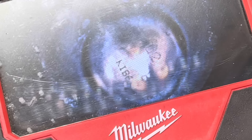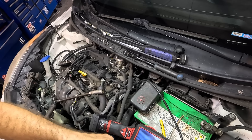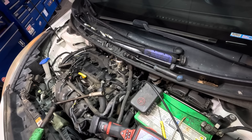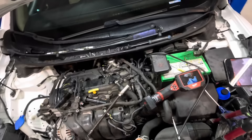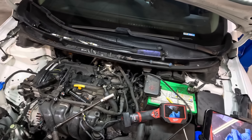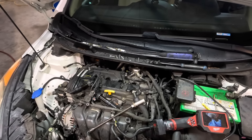Number four — very similar, a lot of build-up around the edge. I think this engine is suffering a blow-by situation due to a worn-out set of piston rings, or perhaps clogged rings with a bunch of carbon, sludge, or whatever built up into the oil control ring. Let's switch gears one more time and do a compression test so we know what the deal is, and then we'll go from there.